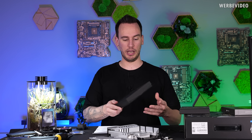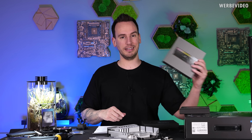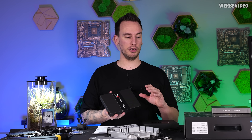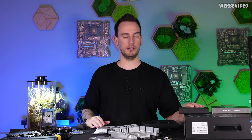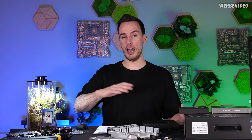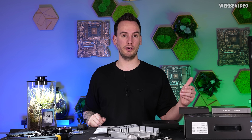We will start with the memory topic. I received three memory kits in total: the Kingston Fury kit included in the MSI review package, a Corsair kit from the ASUS review kit, and a G-Skill kit that came standalone. All three kits are CU-DIMMs — something completely new in the DDR5 era. If you run normal UDIMM DDR5 on one of those Arrow Lake motherboards, the max supported speed is 5600 megatransfers. Switching to CU-DIMM, 6400 megatransfers is officially supported.